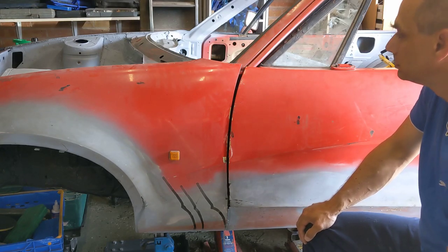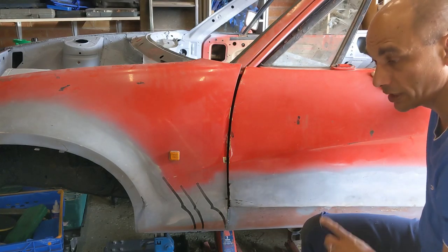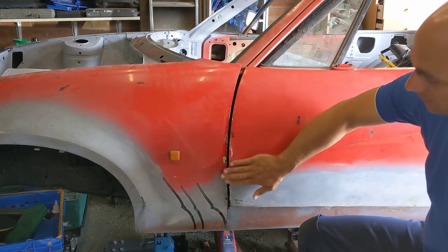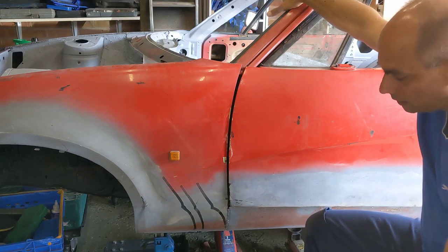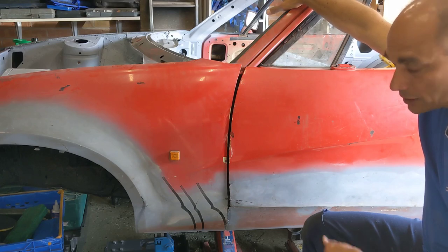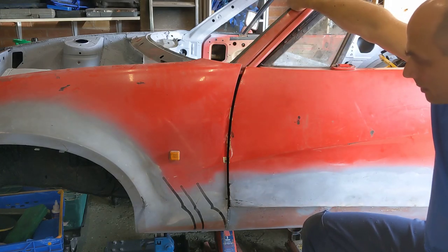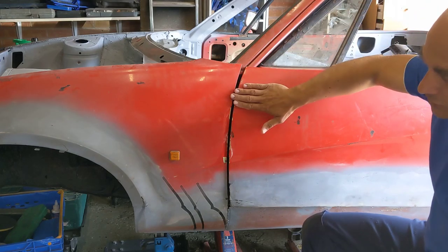What I'm going to do is fit this door on without the modified shim but with the original shim, as it had come off. I'm going to close it and measure the gaps along here and on the other side. Chris has sent me some photos - thank you Chris - and he's measured the gap on his, and it's about 8mm, so I'll check that side for 8mm. I know that one opens and shuts so we'll assume it's 8mm and see how far this one is off.